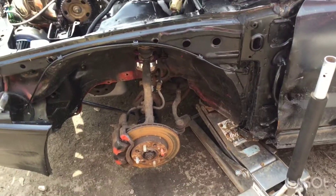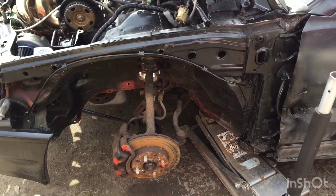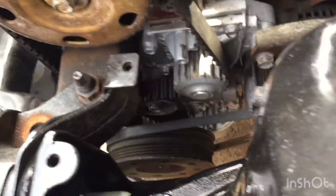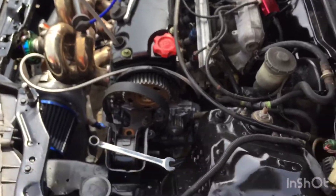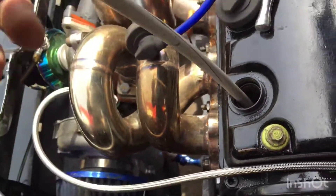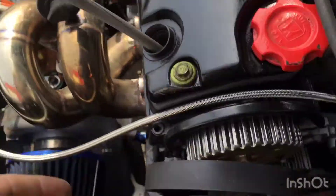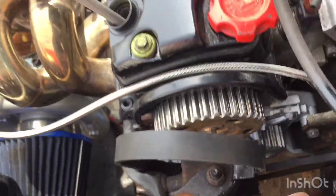All right, so I've jacked it up so far. Next thing I'm gonna do is pull off the harmonic balancer and loosen that tensioner right down there. I'm doing this the kind of cheating way — didn't take off the harmonic balancer, just took out the spark plug, put a little piece of aluminum down in there, and I got it at top dead center.